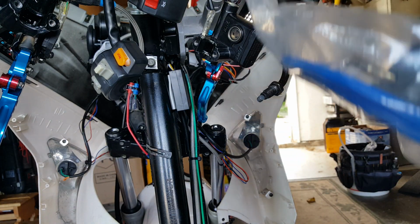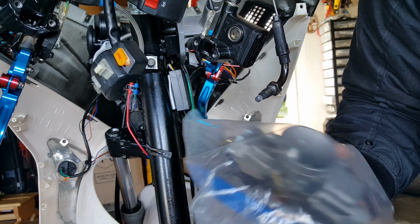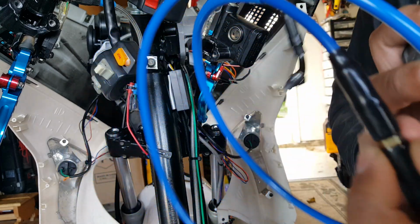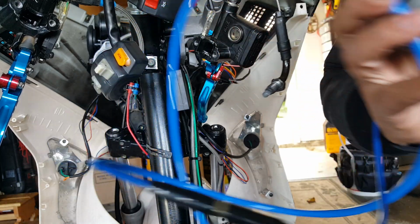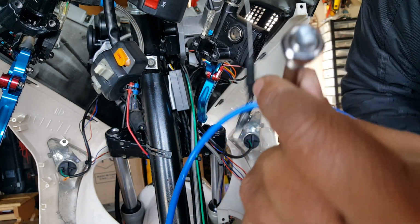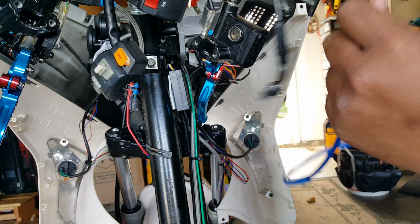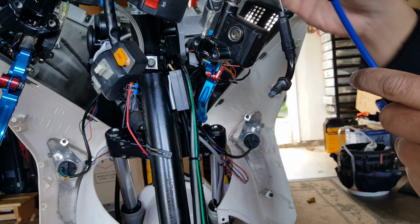Okay, with the PWK, you have several cable adjustments. If you ever need more tension on the cable, the adjustments are located right here, and there's a lock nut for that adjustment right there. See there? And then you also have the adjustment near the handlebar area, which is the one we're actually about to screw back in like this. And we're going to run it exactly like this one has it.